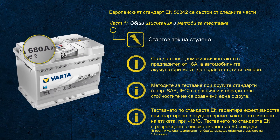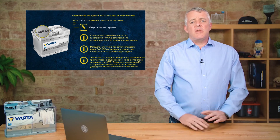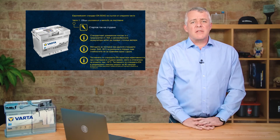Talking about battery testers — considering the test we just discussed, with cooling the battery down and testing for one and a half minutes at very high current discharge, it becomes obvious that handheld battery testers use a different test method with an internal algorithm that tries to determine the CCA potential of a used battery. A word of advice: do not use a battery tester on a new battery. You will just get a random reading and will not get the proper performance of the battery.